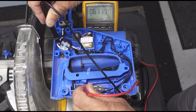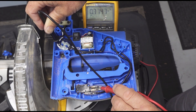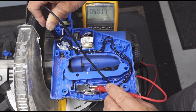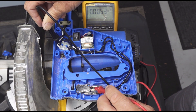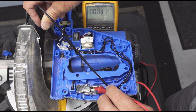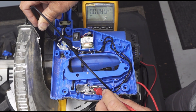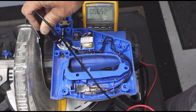When the switch is in the normal position, the normally-closed contact should have power on it, because that operates the brake mechanism that stops the blade from spinning as soon as you let go of the trigger. Let's check that blue terminal — and we do not have power there. So there's something wrong with this micro switch as well. I'm going to pull the wires off and check the micro switch with an ohmmeter to see if it has indeed failed.